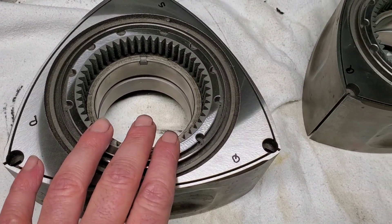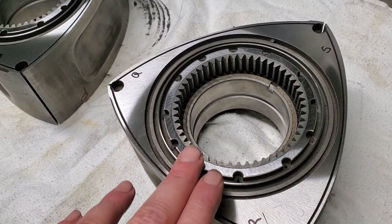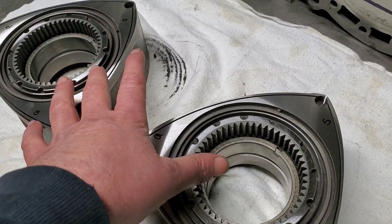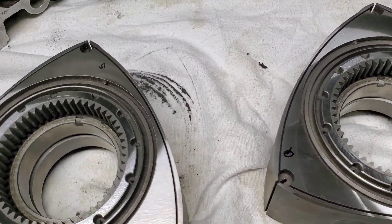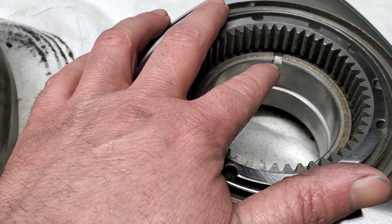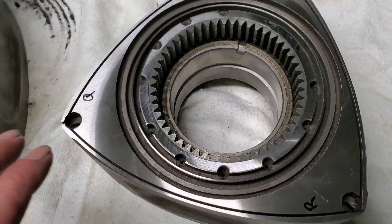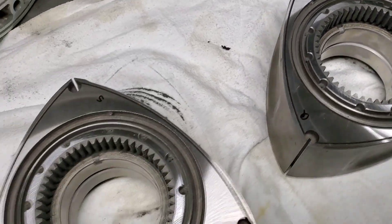You can also see that I was able to get my race rotor bearings installed. I did opt for race bearings — I don't think it's 100% necessary, but since I am setting this motor up for high RPM, high boost, with balancing and side cutting and oil modifications, we're adding in those race rotor bearings. I did a light polish on them. They've been pressed in nice and square to the keyway. I like to use a little bit of anti-seize as lubrication so you're not causing any galling on the way in — keeps things nice and smooth on the press in.